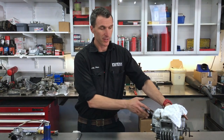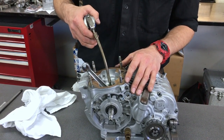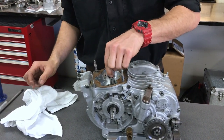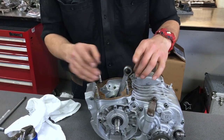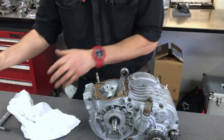Next up we're just going to reassemble the top end — screw the barrel on; the cylinder head's already back together from before so we don't have to do that. Set the timing, double check these, put the carburetor in and then we should be ready to do the engine install on the kart. Grab some oil and just drop it down there on the con rod and down through the oil galleries for the main bearings. A little bit of lube's good. Also on our little end bearing, just as we're reassembling everything, I'll put a little bit of extra oil — that's just two-stroke oil.